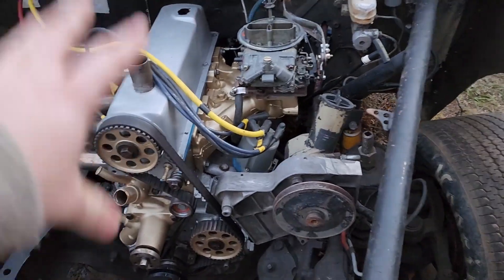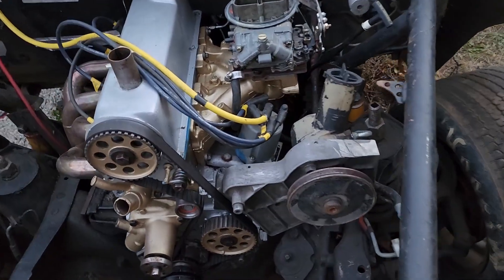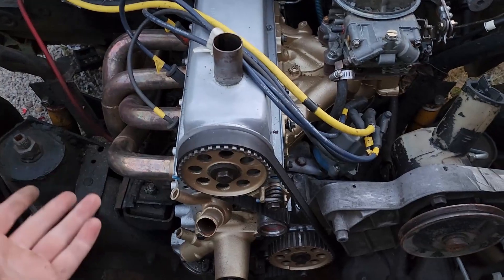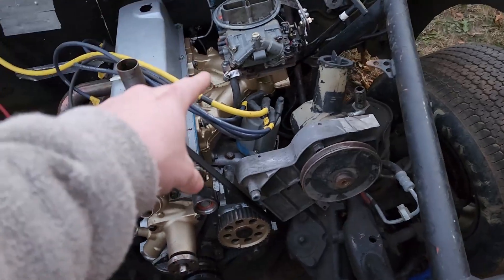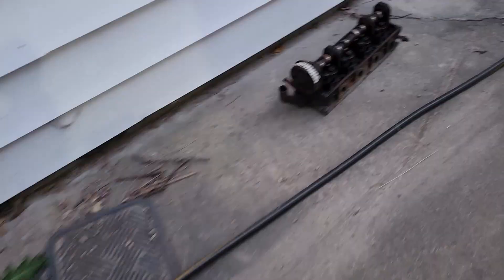With this being a distributor class of racing, I have to use a distributor, I need to use a carb — which means I need to use the old intake. And the only way to do that is to use the old head. So I have the old early 80s head, which allows me to use the old 80s intake and exhaust manifold. As you can see, we have a nice header down there which runs to our carb.